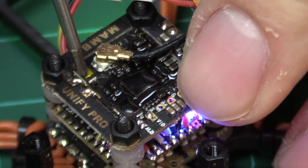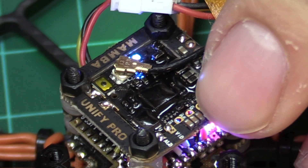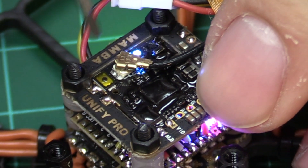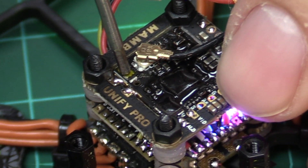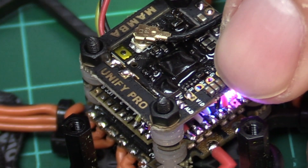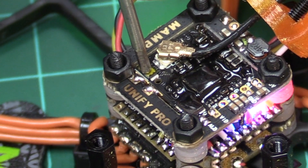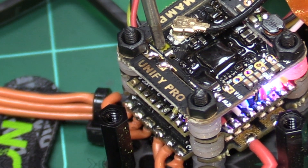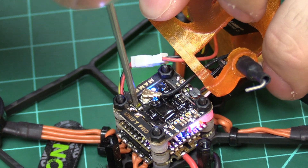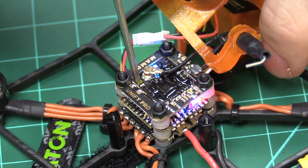You'll see the red light. Push and hold for a second, then let go — you'll get a solid red light and then a blue flash, indicating what channel it's on. Push it one more time for about a second and it's going to flash two red flashes, then start flashing whatever it's programmed to. After the second red flash, push and hold. Keep holding — the lights will start doing stuff: it goes blue, then flashing blue, then solid blue again. That's about 30 seconds in — you're supposed to count to 30.